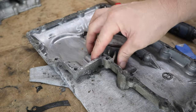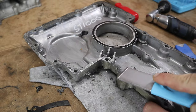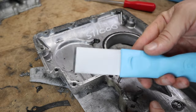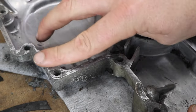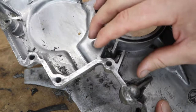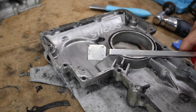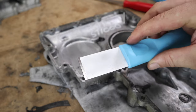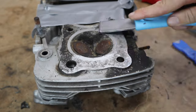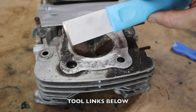This gasket here is so far the hardest to take off — it is really on there in some places. Let's get the tungsten scraper out. Well, I must say I'm pretty damn impressed already. I've only used it over a small section and you've got to be careful not to tilt it or you can scrape the side of the aluminium, but it is so smooth. You probably want to use a scraper first to get the bulk off, then run over it with the tungsten. That surface there is ridiculously smooth — it already feels like it's just come off a machine that's resurfaced it. I'm definitely a huge fan and I'm probably going to invest in one myself.